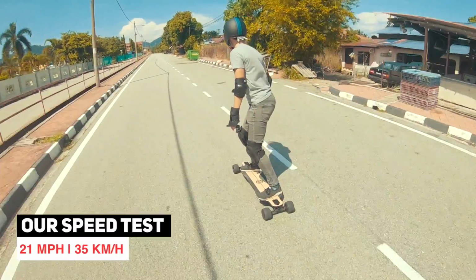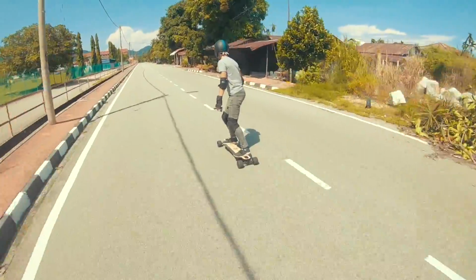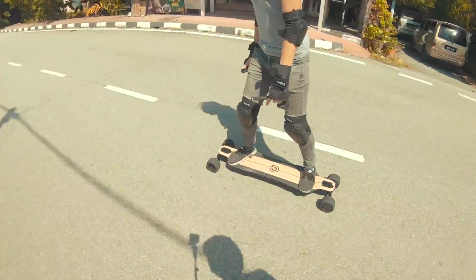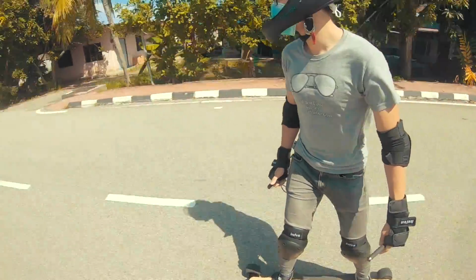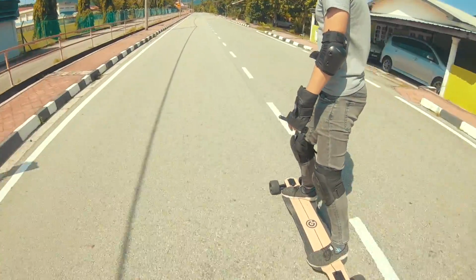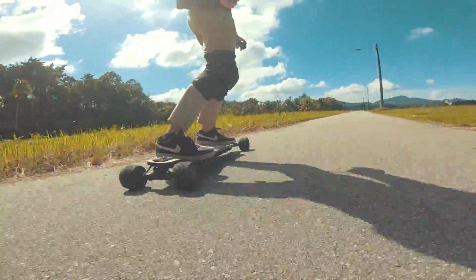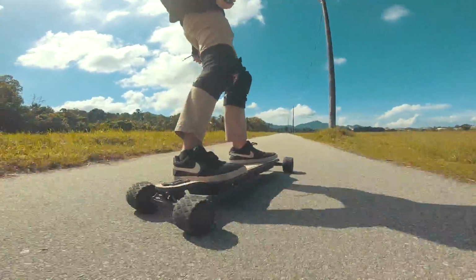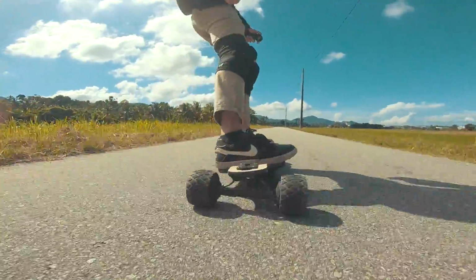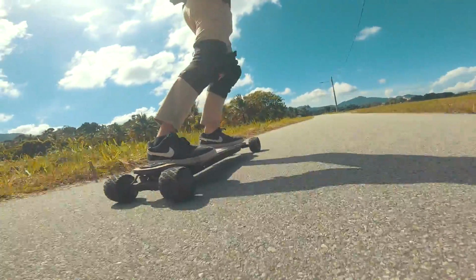You see, when it comes to double kingpin trucks on an e-skate, some brands did get it right, but many didn't, and those who didn't get it right usually end up with wobbly trucks. Ownboard's double kingpin trucks are obviously the latter, and in our opinion, this is the most significant weakness of the AT1W. It has poor return to center, so when you make a turn, it doesn't rebound back and help you recenter. The lack of rebound also means it doesn't help to stay centered. Of course, the double kingpin trucks do allow a small turning radius for tight turns, so there's that.